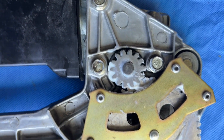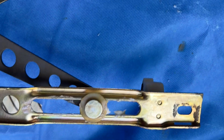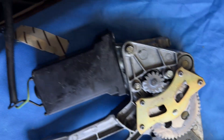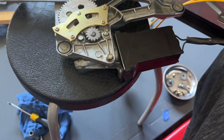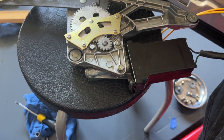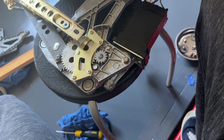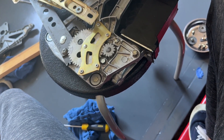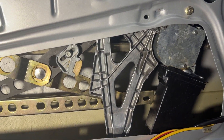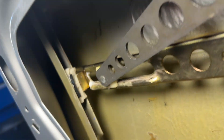You can have a listen now to the replaced motor — it just sounds infinitely better. I've now attached this to the purchased regulator, which I've greased up as well. I've then attached the wiring loom up, and you can see the motor is turning. After putting it under a bit of tension, the regulator arm is swinging nicely and smoothly — that's now ready to go back in the car. Sometimes you want to use the motor outside the car to get the arm to fit in.